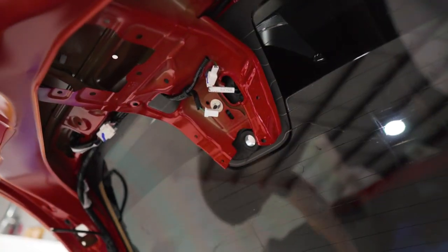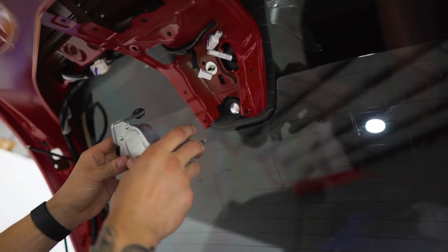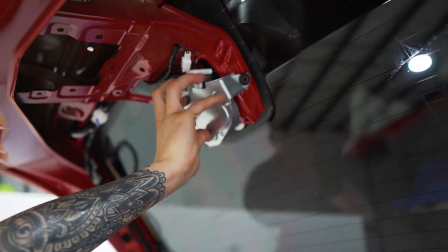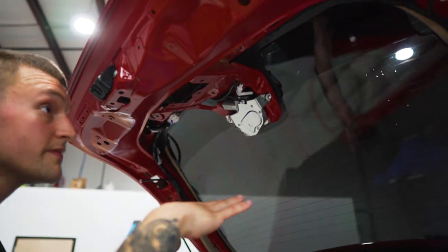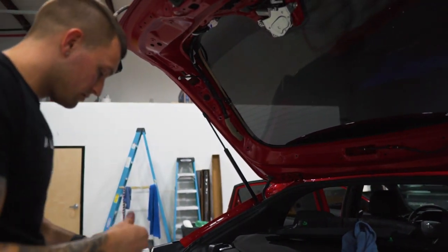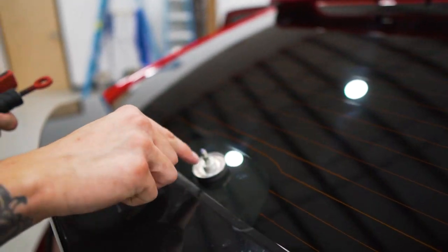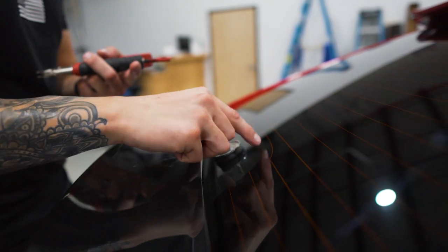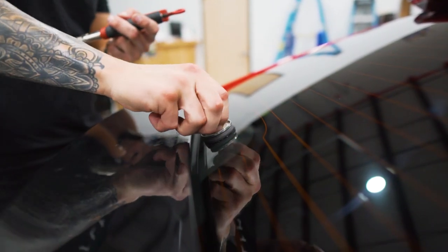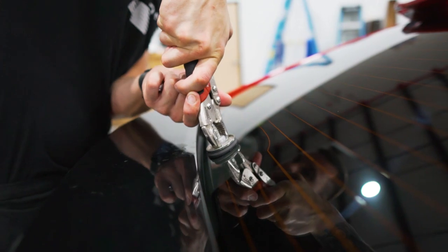Re-plug the brake light. Take the motor with the washer and put it in place. Plug it in and add the three 10mm bolts. Let's put the wiper back on. We'll need a 10mm and the vice grips. First put on the little plate with the hole in the center, with the rounded part on the bottom so it cups up like a bowl. Put the big nut back on — it doesn't have to be too tight, just give it a little twist.